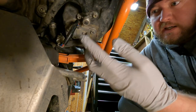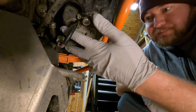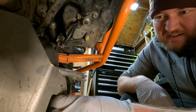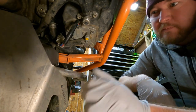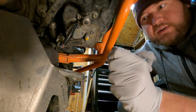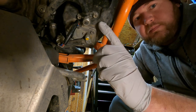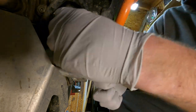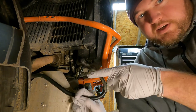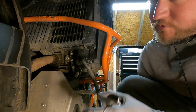Underneath the bike on the left side, this is the housing for the fuel filter and fuel pump. I unscrewed a few bolts to get some of the stuff on the skid plate out of the way. First things first, we have to disconnect the fuel lines and drain the fuel. Make sure you close off the petcocks on the left and right side. I went ahead and popped the left side back on, closed the right side petcock, and pulled the connector line from left to right.